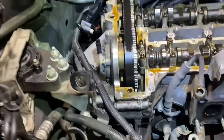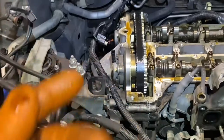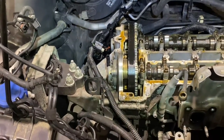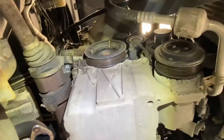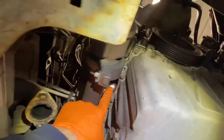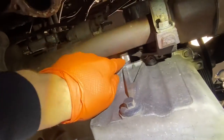Can I take the timing cover off without removing the sump? I'm not sure — we'll roll on and start disassembling this side. We're going underneath and bringing it up in the air to disassemble the timing belt stuff. I have the timing belt kit ordered because I don't have a time restraint — I ordered it after the last job. Just above the driveshaft to the rear, a little size 10 bolt comes out and then you spin in the locking pin to give us the crank pulley position of about one o'clock.